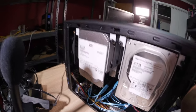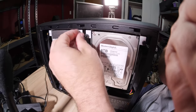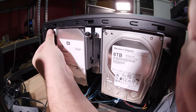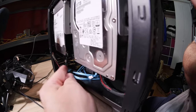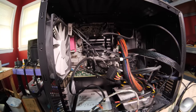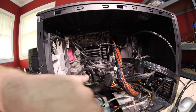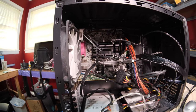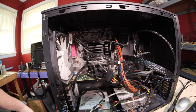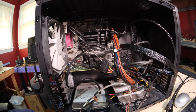Why do you have all these hard drives here, but there's a gap, and you have a spare cable on this nice, fast LSI 9211 controller? Like, why are you not yanking one of these other drives, since you have two on the other side hooked to the internal SATAs? Why don't you pull one of those and put it over here and get the faster LSI thingy to go faster? Well, I'll answer that question for you. That slot is an X2 slot, so it's bandwidth limited. Now, these other ones connect directly to some internal PCI Express lanes and are faster. So the LSI technically is slower. That's why. Less drives on the LSI means more performance. It's just a dumb SATA controller for as far as this is concerned.